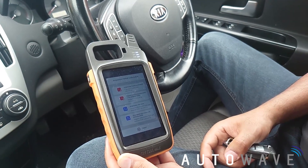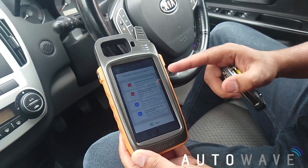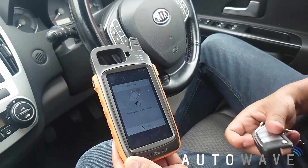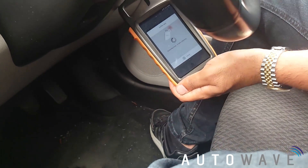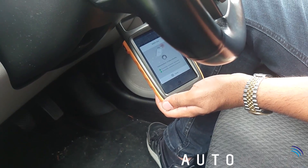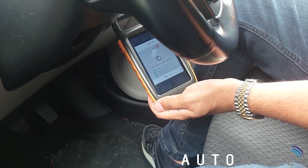The two main methods are the top original key or the aftermarket chip clone. If this was the original key I'd select the top option, but because I know it's an aftermarket key I'm going to select that option. It needs to collect the data by sniffing it — turning the ignition on. I'm going to repeat that eight times, though it often only needs one sniff of the data.